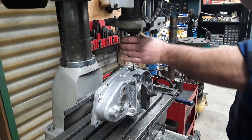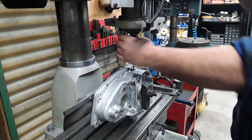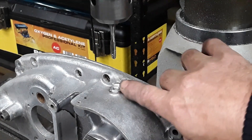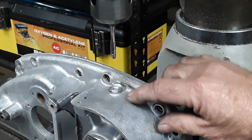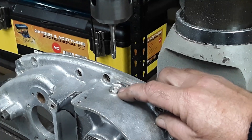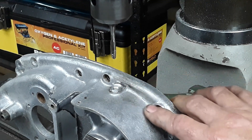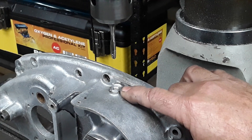We're really happy with where it ran through into the crankcase — it's all going really well. We've just finished tapping it and that's our repair done. The real critical thing is having this face dead square to that hole, because that's where it seals up. Lose crankcase seal and you won't have an engine that will run at all. So we're really happy with the way this went — it's looking good.